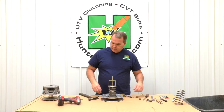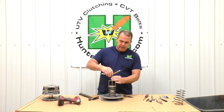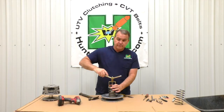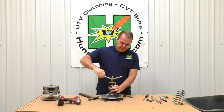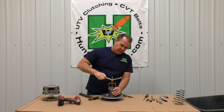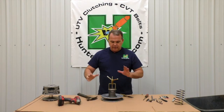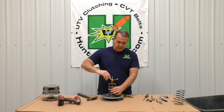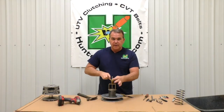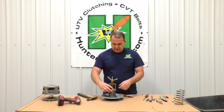I'm going to try to get this a little more centered. When you're doing this for yourself and not on video it seems to go smoother. Now we're actually compressing — get down on it. If it gets out of whack, you can manipulate it over or take your hammer and hit it around to get the hole to line back up. Once you feel it bottoming out, we're done — that's where a lot of people bend these.